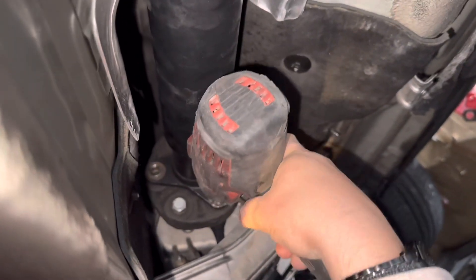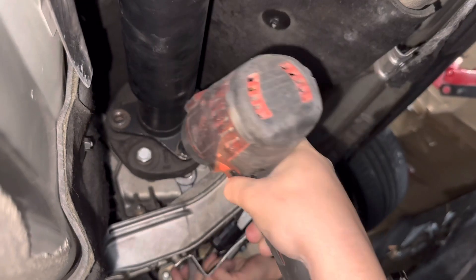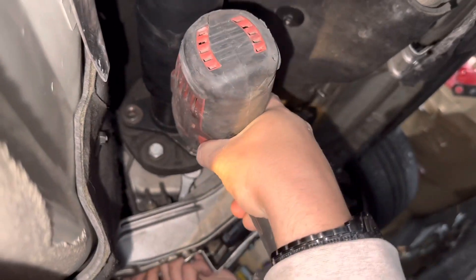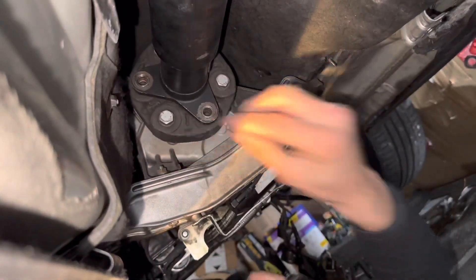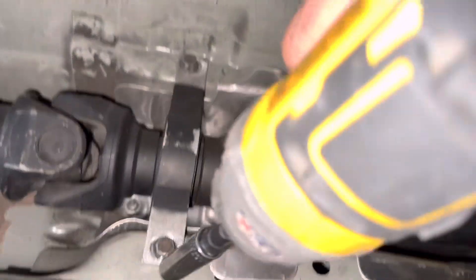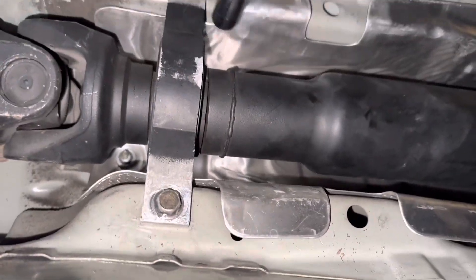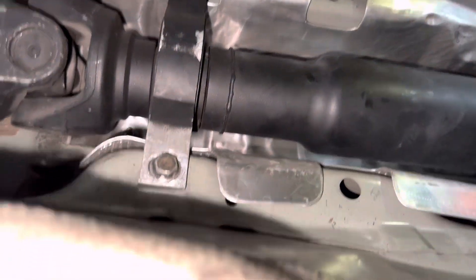Come back here to hold the shaft — it can be done with one person. Once you pull the driveshaft back it comes free, and the nut falls in there — just reach in and get it. To drop the driveshaft down, remove the two center support bearing bolts. Be careful, it'll fall on your face. These are supposed to be perfectly symmetrical.